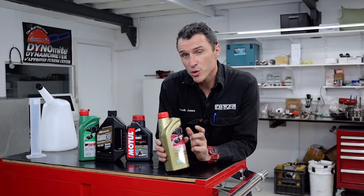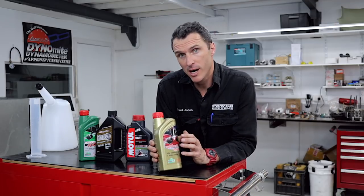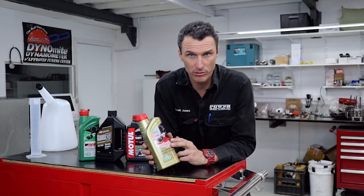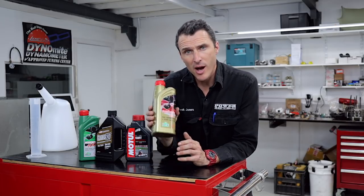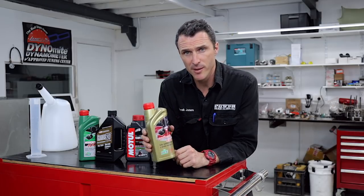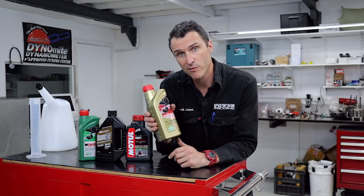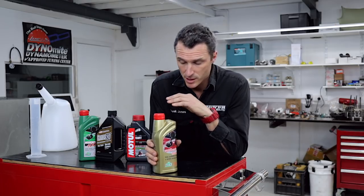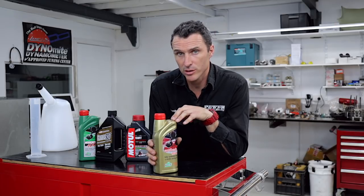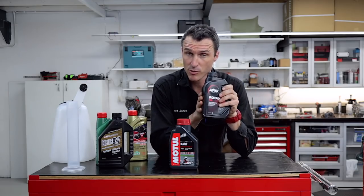With this particular oil, I use 25 mls per litre. You can run it as lean as 20 mls per litre — that's recommended by the Rotax people, and that's a 50 to 1 oil ratio, meaning 50 parts fuel to one part oil, which is a pretty lean mixture for a racing two-stroke. At 2%, you won't have any issues with the engine blowing up. I add a little extra oil for a margin of safety. When running in your Rotax engine, they recommend 33 mls per litre, which is a 30% richer oil ratio.